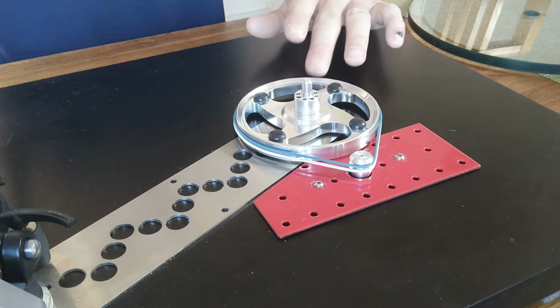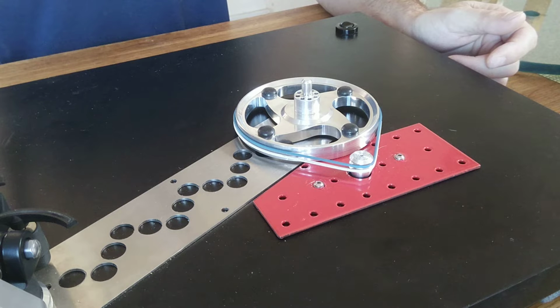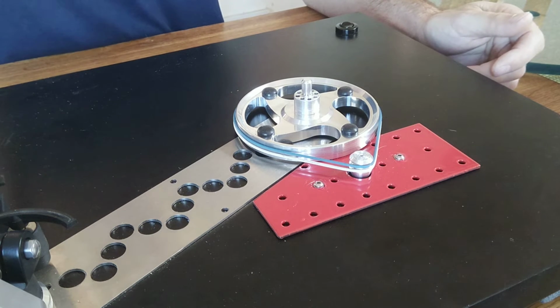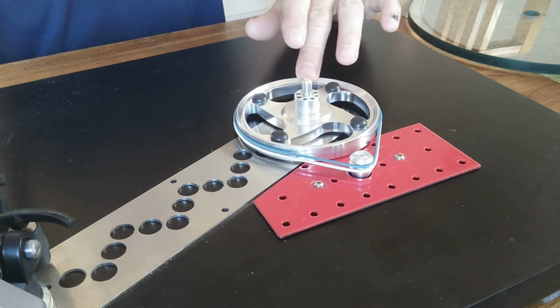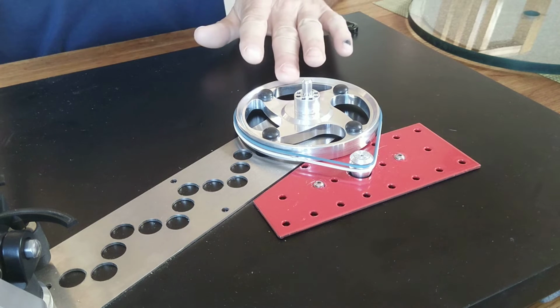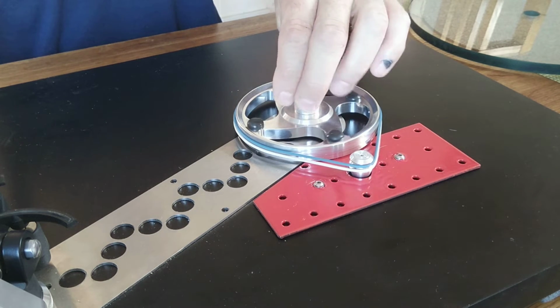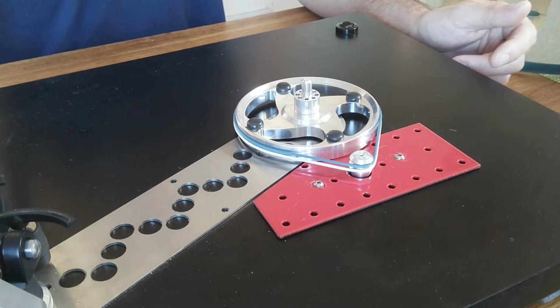There's several variations of this. I like this particular one because he's taken the thought to produce these teardrop shaped cuts, which I would imagine help greatly with losing any ringing that you get on the sub-platter. I will say that any motor and bearing noise that you might have present suddenly becomes a lot more noticeable when you put a metal sub-platter on. The original plastic one does actually do a great job of deadening any bearing or motor noise, and I did notice a noise when I had this installed, and I wasn't very happy with that, but it turned out that eventually, after a lot of faffing about, it was my motor that was failing and that noise was coming through. But if you've got any problems like that, you will notice them more with a metal sub-platter.